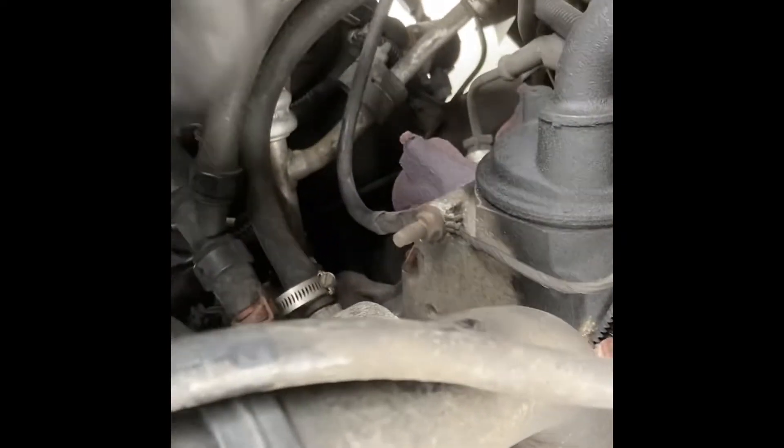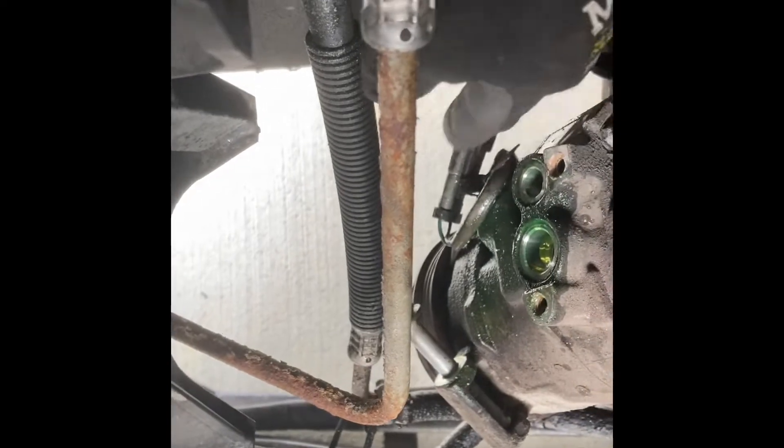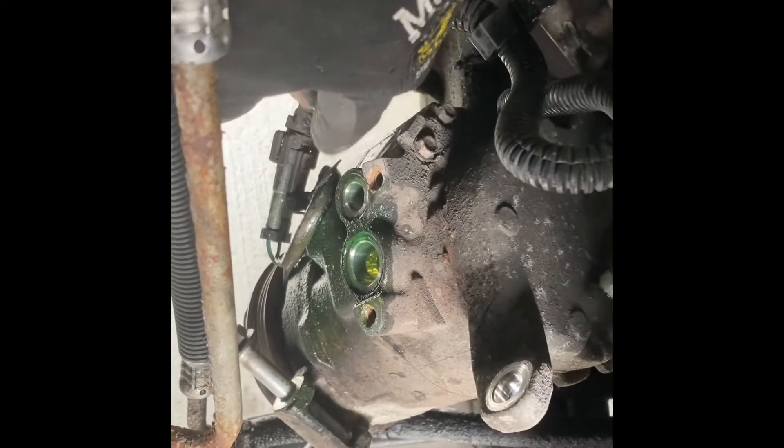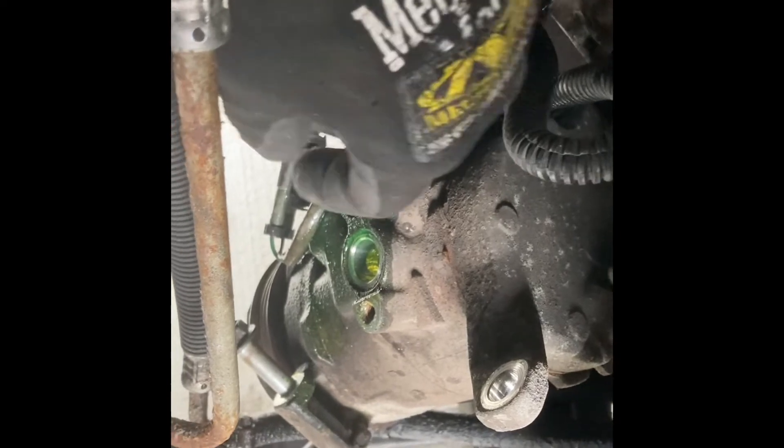So I'm going to have to do it the old-school way — just let it out. As you can see, she is off. Word of advice: the two lower bolts underneath — you need to have them on there when you're putting the AC compressor back. Because if you don't, there's physically no way to put those bolts in once you have the AC compressor in its place.